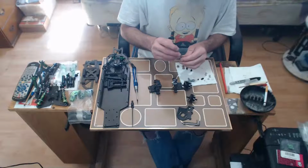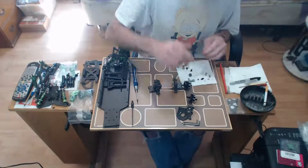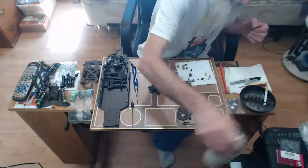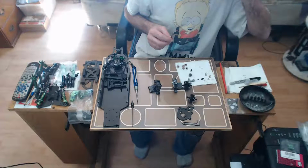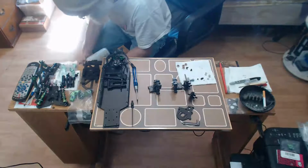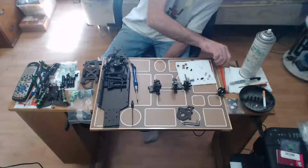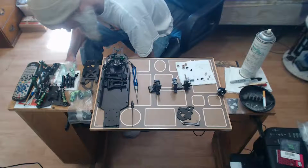And we'll slide this little puppy in. Yesterday I had to actually tap that puppy down into place, so I'm going to have to do the same thing here. This is an aluminum top shaft, not steel, so you're also cutting your rotational mass. I'm using the Traxxas stock 22 tooth top shaft gear, which is kind of heavy. It's a steel gear. I'm going to go ahead and clean it and brush it because I didn't do this one yet. Get it cleaned up from all that marine grease I use. A little too much in there. I want to clean these teeth out.